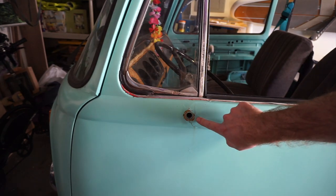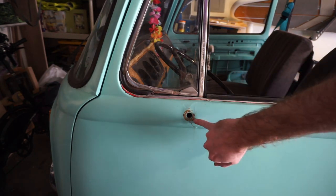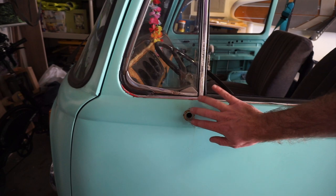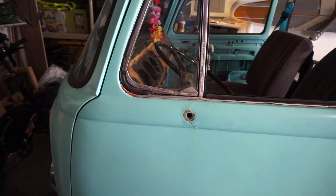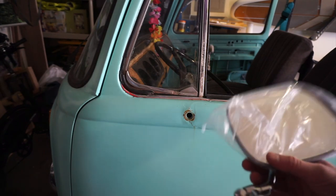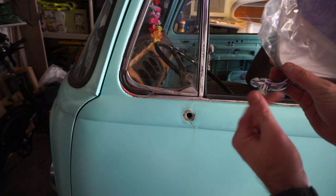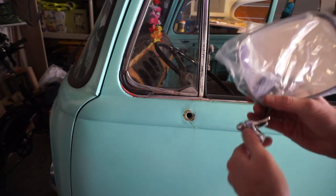The threads look good. I ordered a nut to go on the backside, which is kind of difficult to thread in there, but the factory threads are good. We're going to repaint this, so I'm just going to slap the new ones on. There is a gasket they sell that goes over it — I bought one of those to help prevent water getting in and rusting your door out. I've seen videos where people don't use the gasket. The mirror threads in, and there's a little nut that acts as a jam nut, so you thread this in and then tighten it down to lock it in place.